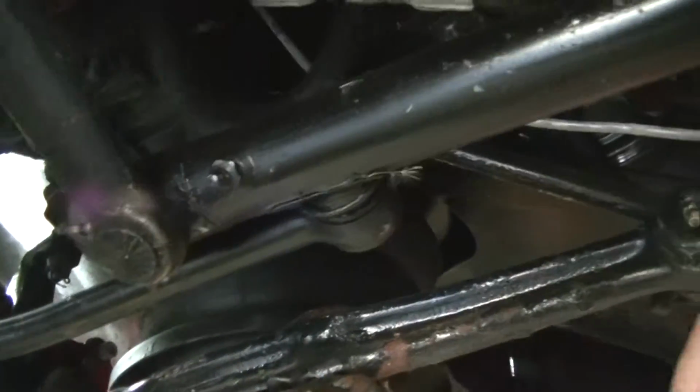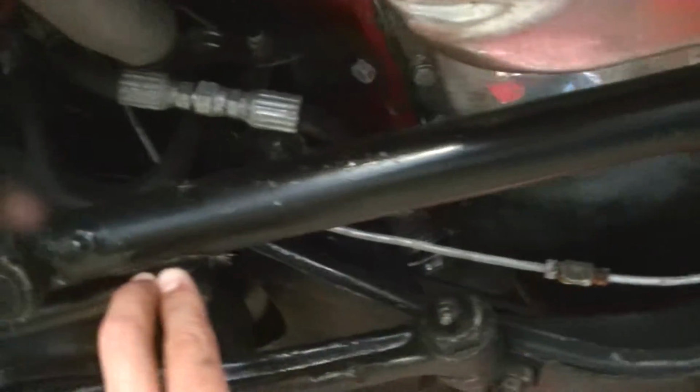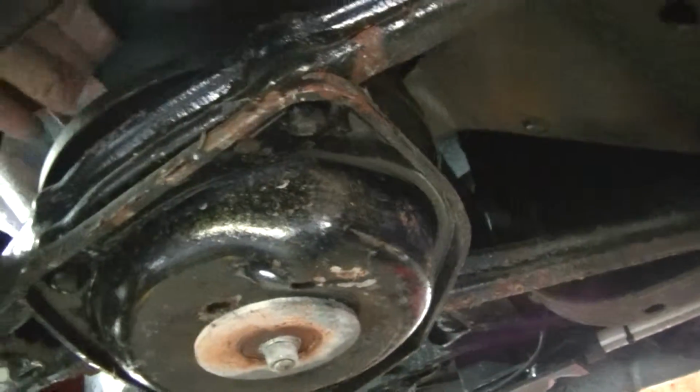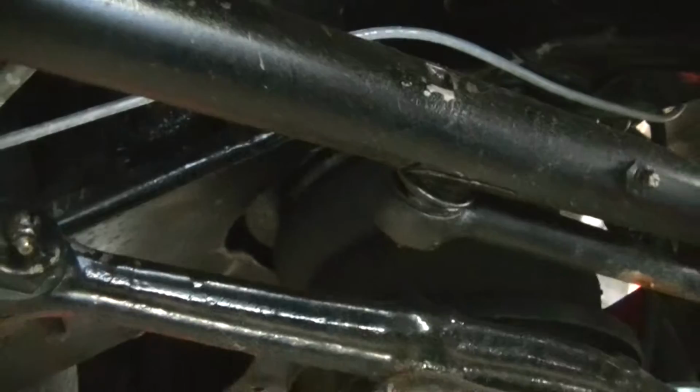You know, these, you need to grease these. You need to grease. Yeah. If you don't grease, this bushing is dry. Loose, yeah. Because you pump it in until you feel the grease come out of this. The rubber here is not worn out, so it's in very good shape here as well. Yeah, I think that's the suspension. You can tell the suspension they did very recently.